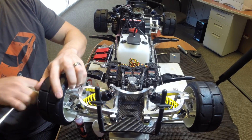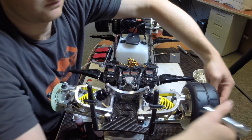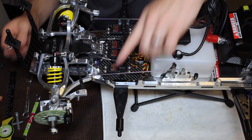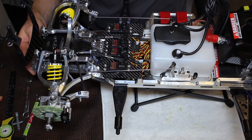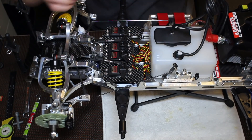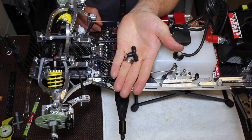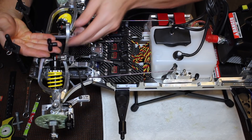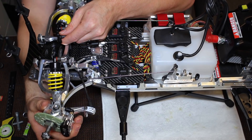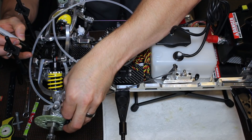First you'll want to remove the tires from the assembly. This will expose the calipers. What you have here is a couple of different connections — you've got this PTFE plastic line that acts as your hydraulic brake line, some T-piece connectors that sit up front to tie the two front calipers to the one master cylinder. Make sure you have enough slack on the line so that you have movement for steering.